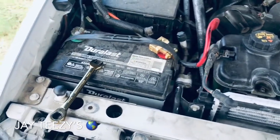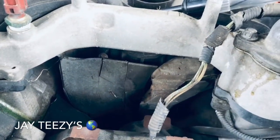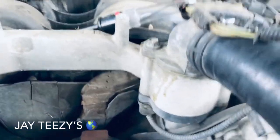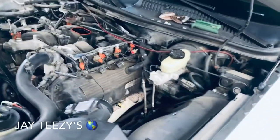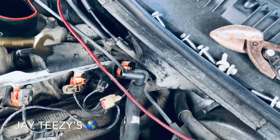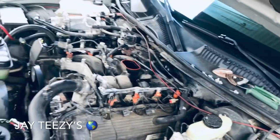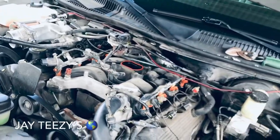I'm going to show you how bad my intake was. I ain't got it out yet — look at that. That gasket exploded off in there. The hardest part I've run into so far, with everything broke down, is the bolt on the back of this bracket right here. It's a 15 millimeter, at the back side of that bracket. That's the hardest part so far. You can tell it was bad because it's got coolant running down right there. That gasket there was pretty bad.